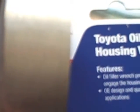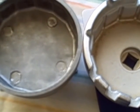The American-made one takes a 15/16th socket on the hex. Anyway, I hope this is helpful. I'm personally in favor of the second one. If you're just going to do normal oil changes, the first one is fine as long as the filter isn't put on too tight. But if it is put on tight, the second one is the one to use. Hope this was helpful so nobody has to go through what I went through.